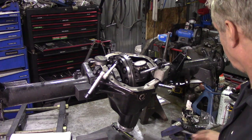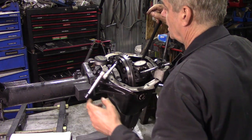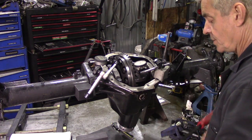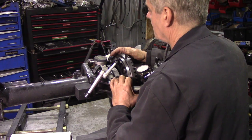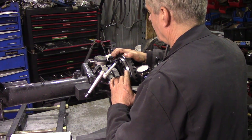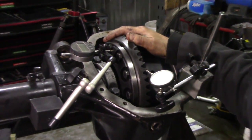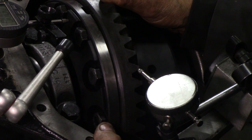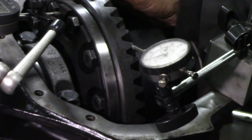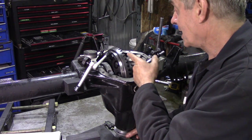So what we're going to do first of all is push the differential over to this side like that and zero it. That's zero. Then we should have an awful lot of backlash. We're going to push this up to there and set that on zero. Next we're going to look for backlash - that's our backlash, you can hear it. We might have to tighten up that pinion just a little bit more because it's a little bit loose. We want to test the backlash on the crown wheel - that's the important thing.